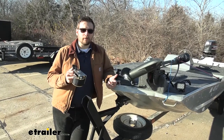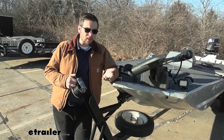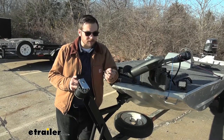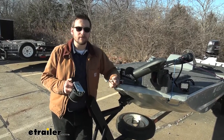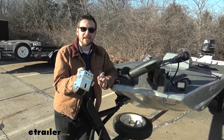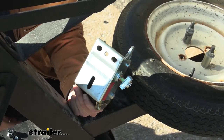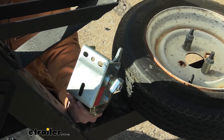To begin our installation, what we need to do is remove our older winch. Now if we don't have an older winch that might put us in a tough spot, because we do want to retain the hardware from older models. Personally I would recommend trying to get three bolts in there — two is definitely going to do, but three is always nice for safety. If you do need hardware, you just need three-eighths inch diameter bolts. For length, you just need to make sure you get through your mounting plate and your frame, which can be a little dependent on your setup at home. Now we need to take note of our mounting positions — these are kind of universal cutouts on a majority of winches, so hopefully you have the right spacing, otherwise you may need to do a little custom drilling into your frame.